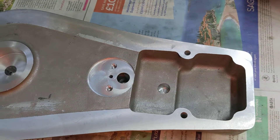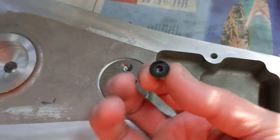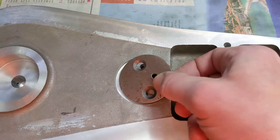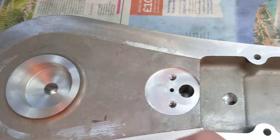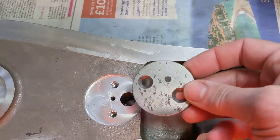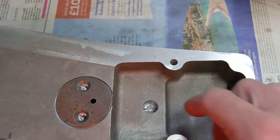So what holds it all in? Well, this plate here holds everything in. It's drilled and tapped to take these nice countersunk screws that go in either side, and of course what this does is two things: it blocks off this hole so oil coming this way and then up can't come back out into the cavity. It carries on, and it also allows the oil that does come past the oil pressure relief valve, if there is ever a problem, to come through this hole here and dribble back down into this chamber.